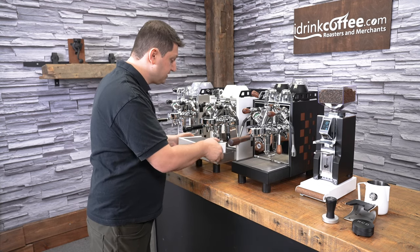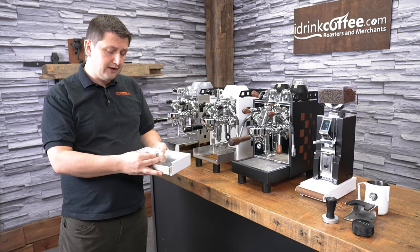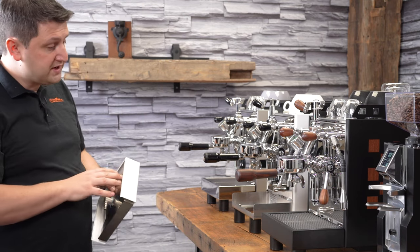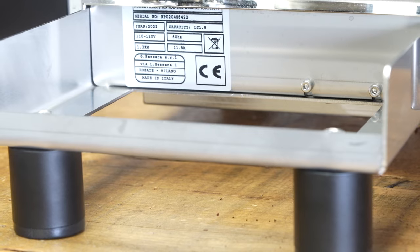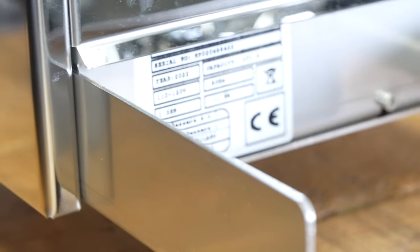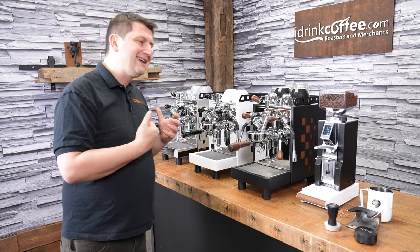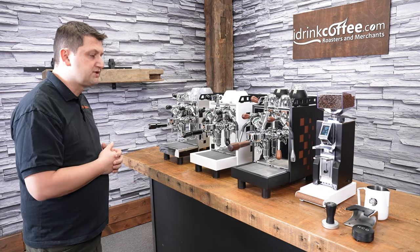Lastly, we have the drip tray, which is actually a decent size for a compact machine. The drip tray also has a connection so you can drain it — you can hook this up to a drain or into a larger jug. With the drip tray off, I'll also point out some of the build quality features of the Bezzera. The entire frame is made out of stainless steel, which is a really nice touch because a lot of machines use painted steel for the base with spot welds. Bezzera is nice and solid. On the inside, the Bezzera Aria is powered using a one and a half liter heat exchanger boiler, which is a good enough size for home use — you'll get plenty of steam and be able to make lots of espressos back to back.